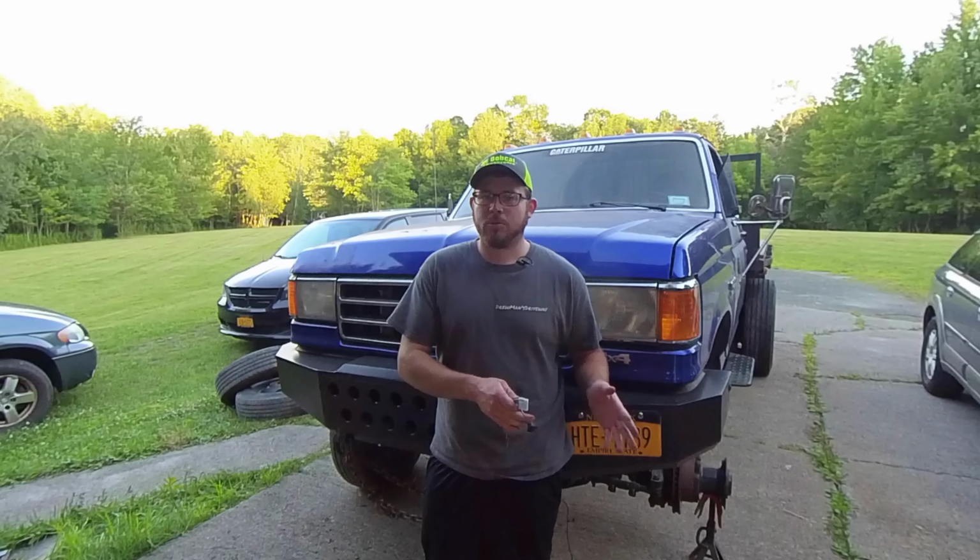So I had Cat hook up to it and change a couple of settings. They had to turn on the J1939 as well as change some transmission settings to change it from the manual style Allison to an electronically controlled Allison. So now the two are talking to each other. Jason said go ahead and take it for a test drive.